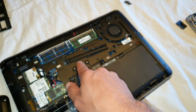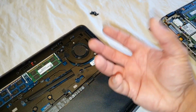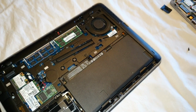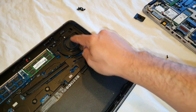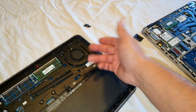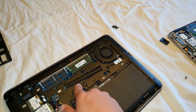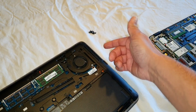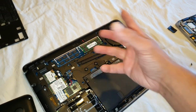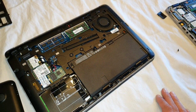You should know that. If your computer one day is overheating, you're going to need to clean the heatsink, because inside there will be lots of dust hidden, and you will not be able to see it from outside. The first reason why your notebook gets overheated is that it's full of dust, and the hot air cannot get out quickly, so it runs very hot. After this problem, the second problem comes, which is the thermal paste. Because your notebook was running so long, so hot, and the air was not able to get out, the second thing that happens is the thermal paste degrades. Okay guys, so you're going to need to replace it with a newer thermal paste, and you're going to need to take all this stuff out to get inside.